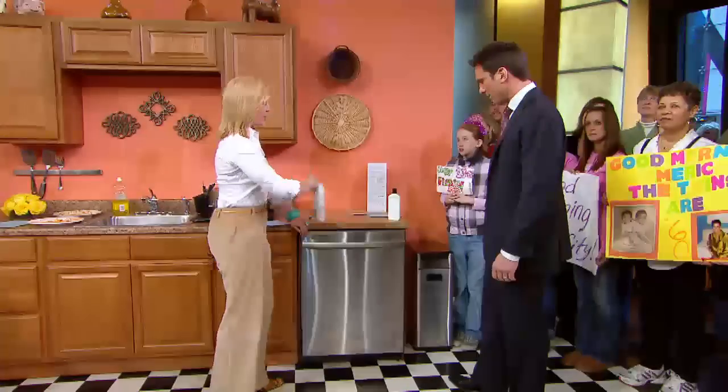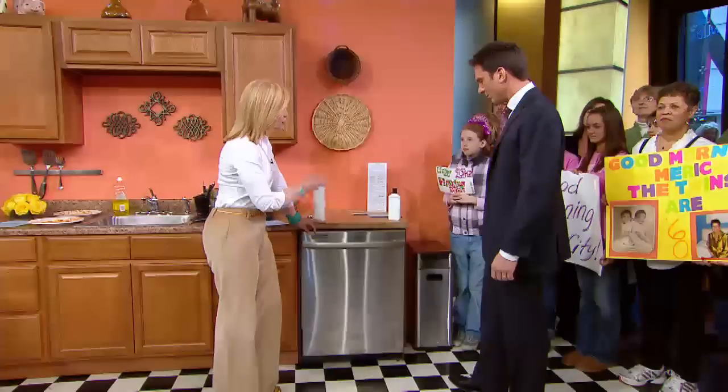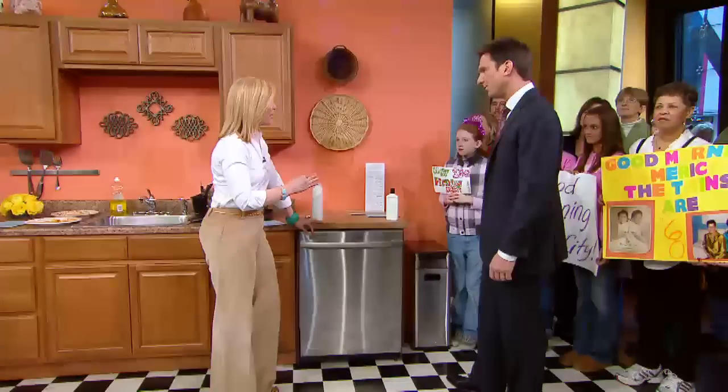Yeah. And that takes care of the buildup in the dishwasher. Using too much soap is the main thing that causes that bad smell, because the soap scum actually lets bacteria breed. So funny enough, the thing that's supposed to help you clean can make it a problem.